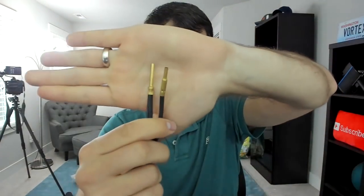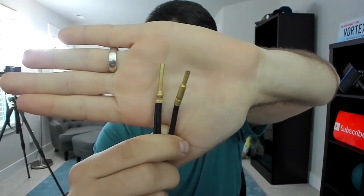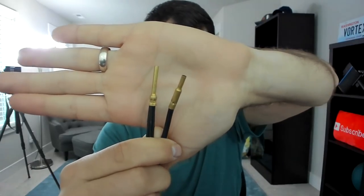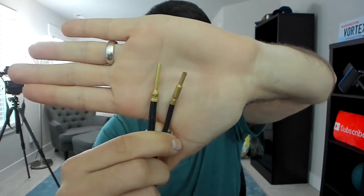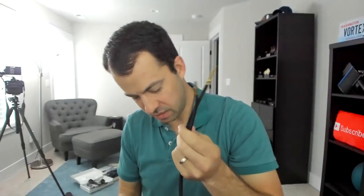I'm going to put two fiber heads by the license plate going close together, two by the driver's side headlight, and two by the passenger headlight — so a set of triples like that. The crimps look fine, I don't really see any issues. The main thing is they're really compact, but they are pricey — roughly twice the price of a comparably equipped ALP. So not cheap, but if you're looking for the stealthiest install possible or your car doesn't have a good place for traditional jammers and you don't want to cut your grill, this could be an option.